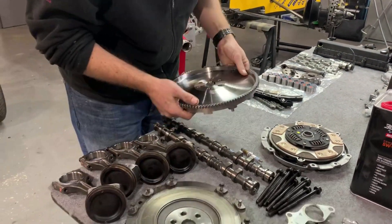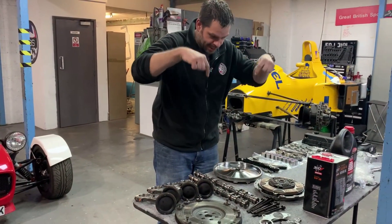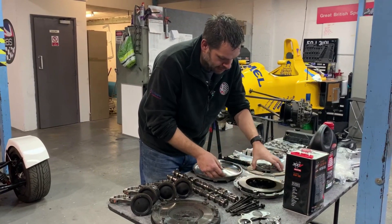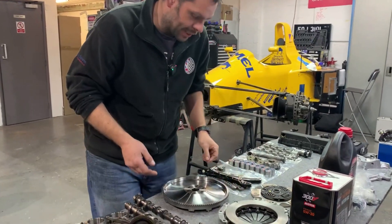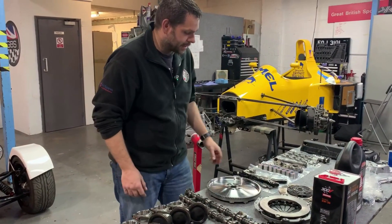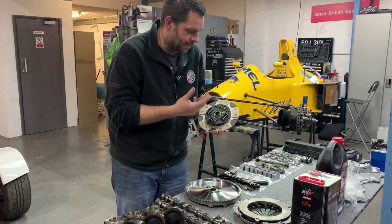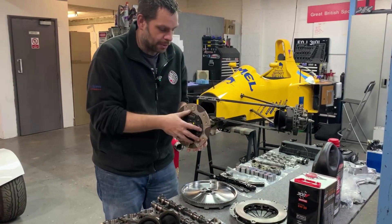There's a considerable weight difference between the two — I don't have the numbers but we'll drop that in below. Clutch-wise, we've got a slightly upgraded diaphragm. As we're pushing the boundaries in terms of power, we're also increasing torque, so it's important that with this engine option we provide enough clamping force. We do that by an upgraded pressure plate but also by the clutch plate material itself.